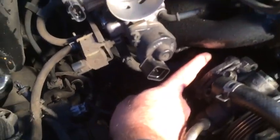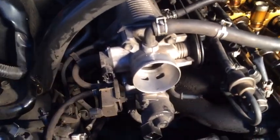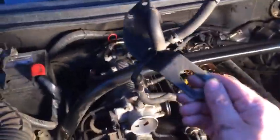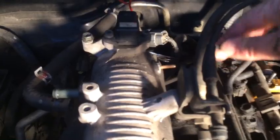I've also removed the brake booster hose and the evap purge hose. There's a coolant bypass hose down here that I've unhooked from underneath the manifold connection, and I've also unhooked the other coolant bypass hose — the one connected to the coolant bypass pipe we unhooked earlier from those two bolt holes. The last thing is the fuel pressure regulator hose — this little tiny hose here — pulling that off now.